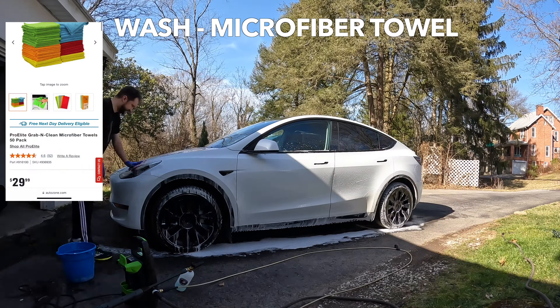Now we rinse with the pressure washer. No need to dry, because after the microfiber wash and pressure rinse, I'm stripping the rest of the contaminants off with a clay bar. It's Meguiar's — good for any color and can do 10 to 15 cars. This is a tedious process, but it's really effective on getting all the way down to the clear coat. I've got a spray bottle to keep the surface lubricated as I move along the car with the clay bar. Mine is just water. People also use soap, and there's way more than one way to do this correctly. As long as the surface is lubricated and you don't feel a drag on the clay bar, you're doing it right.